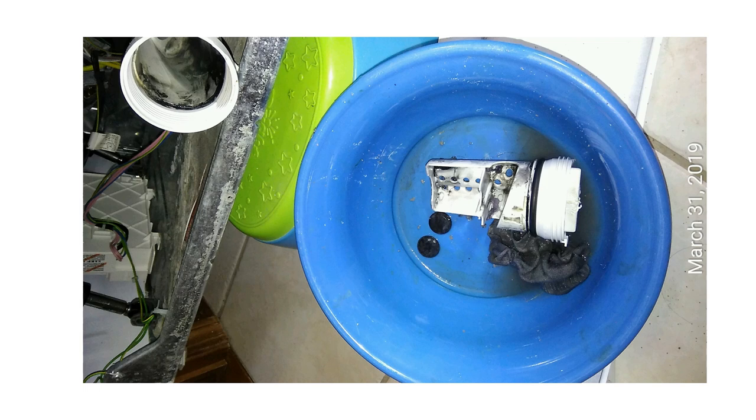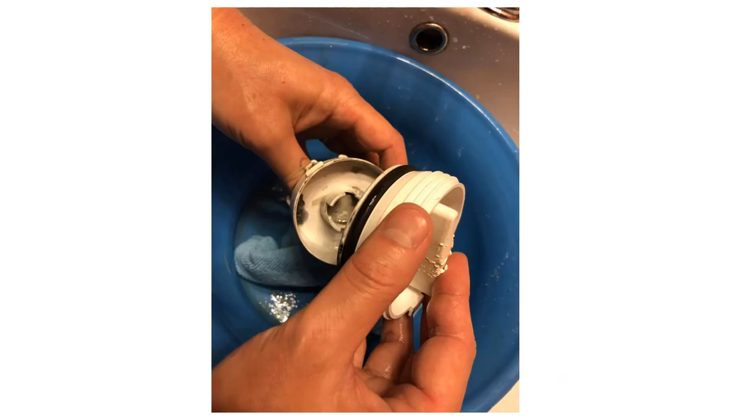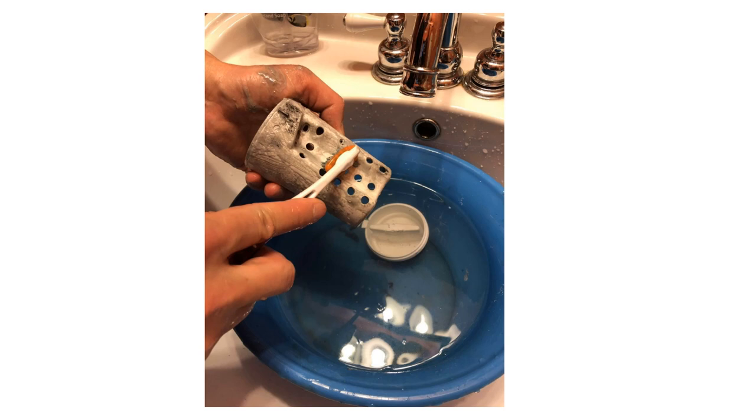Let's look at the items — two quarters and the sock. Let's remove them and throw them away. In fact, I cleaned the two quarters and saved them. The cap and the screen can be separated, so I separated them and rinsed with water to remove some of the dirty stuff inside. Then I used some soap and a toothbrush to clean the screens. It not only makes it look better, it will probably kill and remove some of the bacteria growing on it, and that should be better for your laundry.